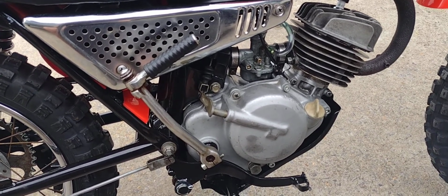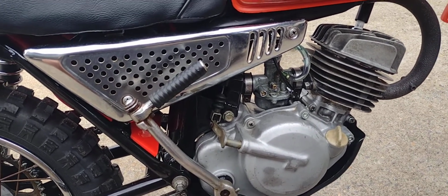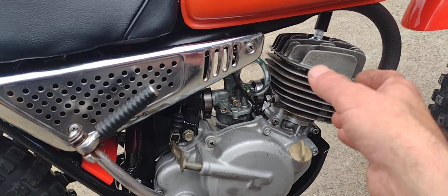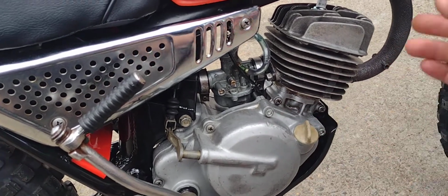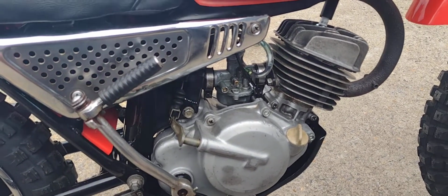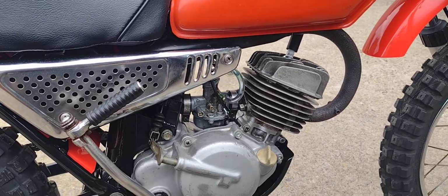The reason we don't hold it at 1 RPM, we don't want the piston to just be doing a mono motion. What you want is you want the RPMs to rise up and down, and that's going to make that piston work a little harder one way or the other as your RPMs are going up and down. And that's going to help break in the piston on the intake port side and the exhaust port side. You're also getting a little extra dose of oil when you get on the gas and off the gas without burning it off. Everything's looking really good so far. Sounds real good.